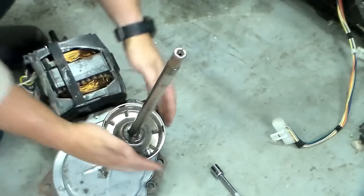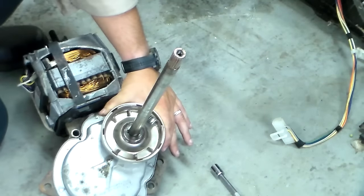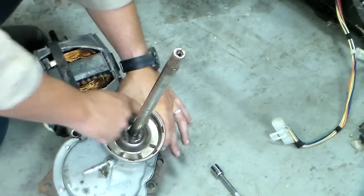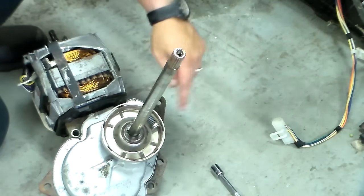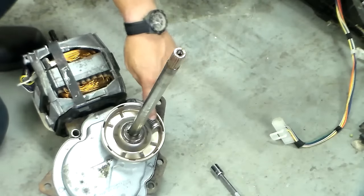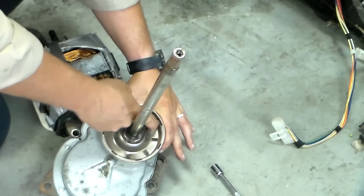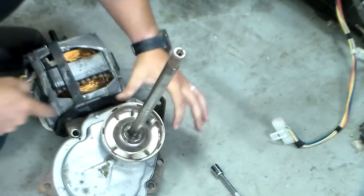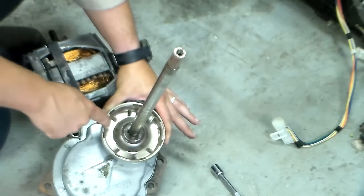So hold this still and go ahead and try to spin that. Now this one here definitely does not have a bad clutch. It did have a bad clutch when I got the machine in, but I went ahead and put a new clutch on this. Now if your clutch is bad, you do not need to take this whole thing off the washer. I am going to put a link in the description below to the part number for this clutch band. If you have a bad clutch, you get to this point, your coupler is good. You come up here, you pull this out and you can spin this around — it moves nice and easy. I can barely turn this and that means this clutch is good. But if you get in here and you hold this still and you can spin this around pretty easily, you have a bad clutch and you are going to want to replace this.